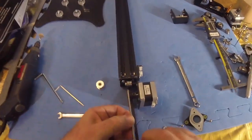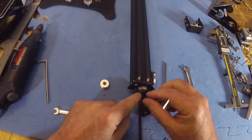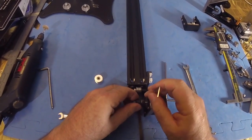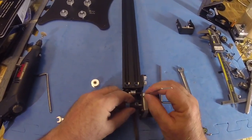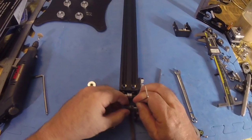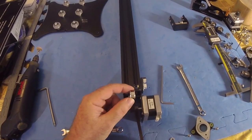There's a very interesting thing that's going to happen. When you start to put the new idler pulley here and tighten it down, what's going to happen is the pulley is going to stop rotating because they're using kind of like a threaded tube that's been tack-welded or spot-welded to this motor bracket. By removing the original pulleys and putting this here, by the time you tighten this up, the idler pulley will not rotate. So what you have to do is take one of these off.